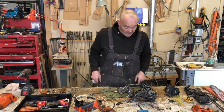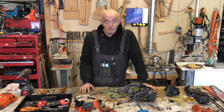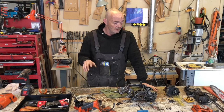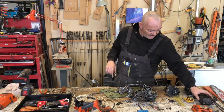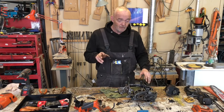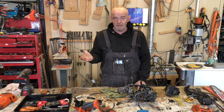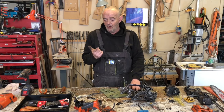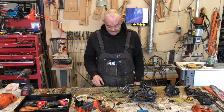And there's a reason for that. It would never, ever be my main saw again, because it's too worn. The engine mounts are worn. The oil pump housing is worn. There are so many things that are worn on this. Am I expecting the muffler to disintegrate again before long? Yeah. Because it's a professional saw. If you were a home user, would I expect this saw to last you, in some cases, if you just started it up a few hours each season, a lifetime? Yeah, I would. However, these two-stroke engines are designed to run on tick-over and flat-out. So it's either on tick-over or it's running flat-out. And that's the bottom crank bearing gone.